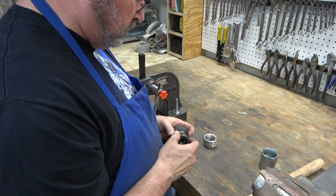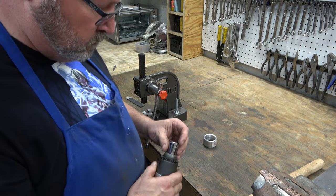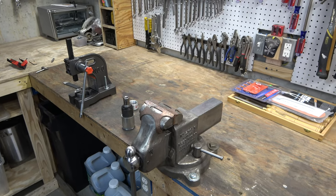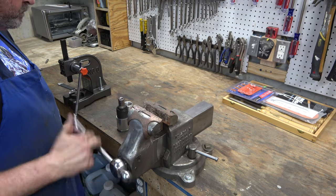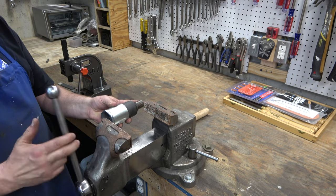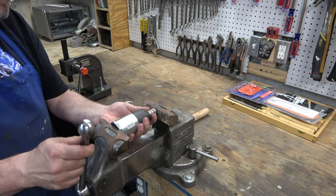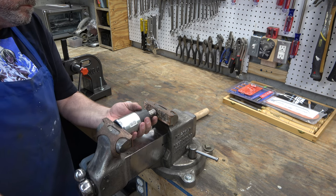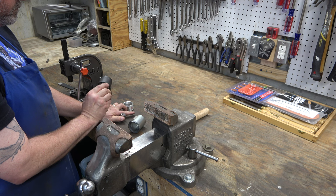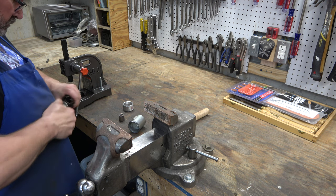That got us started as far as disassembly. Now I use another coupler from Home Depot and a socket. If you don't have an arbor press, this is probably the best way to do it if you've got a large vise — this is how I did it for a long time before I had an arbor press. We can just put it right there in the vise, make sure everything is lined up, and crank it down. I should have done this over the table instead of trying to keep it in view, because as soon as I got that sleeve off, the split ring fell — no big deal.